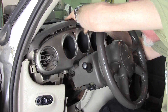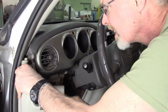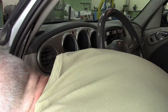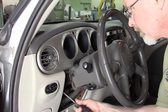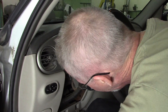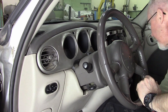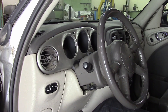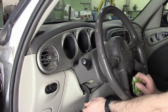Just argue with it. Total time: 28 minutes — not bad, not bad. I've never done this before. Everything just kind of snaps together and it's sort of all held together by everything holding itself all together — it just seems hokey. Two screws again on that left side panel and the bottom guy slips up and snaps into place with a smack. Two screws on either side of the center. Put the console part in. One screw at the top. Snap in the switch. There we go — easy peasy. And all the little knobs go back into place on the heater controls.